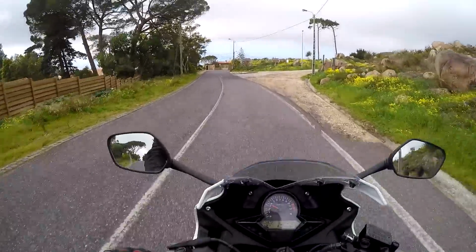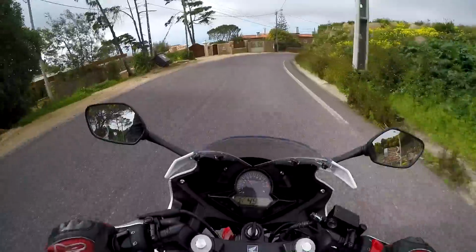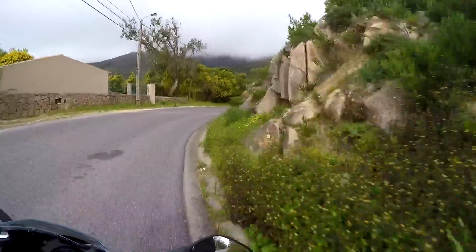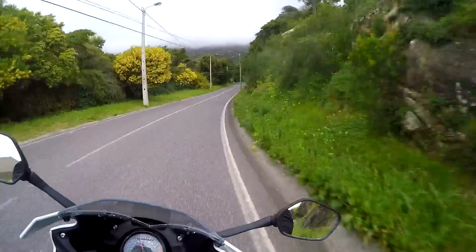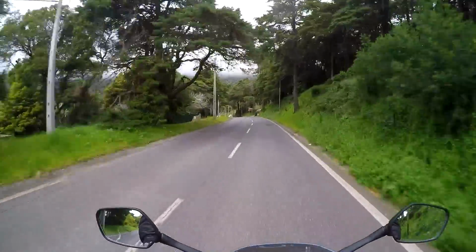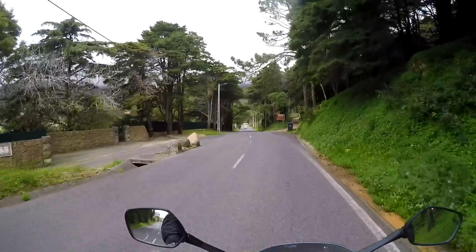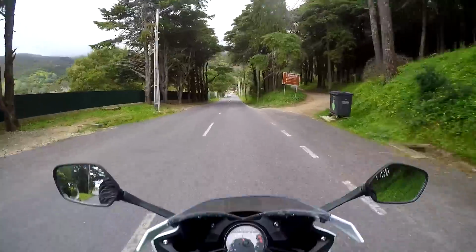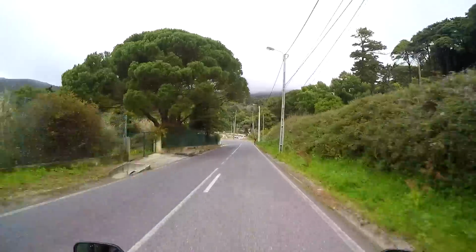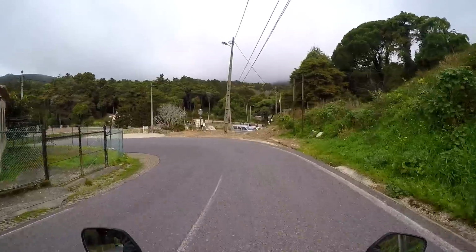Well, now it didn't happen, but previously when I hit the front brake harshly, activating ABS, the front went a little jittery. It actually changed direction quite appreciably. Why? Because it locked up, because the ABS is not quite that intrusive. Let's try it again and try not to die. And I could feel it, yeah. The brakes are nice, okay? The brakes are strong, but the ABS lets you lock up a little bit before it starts activating, which is bad on one hand.